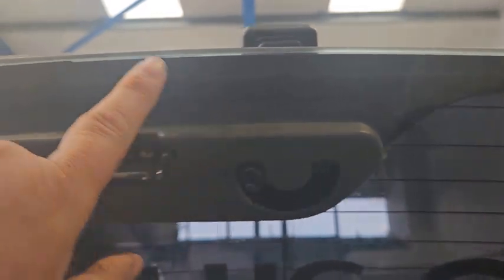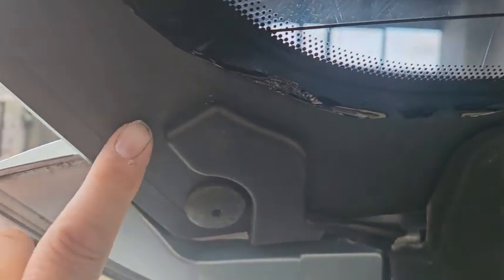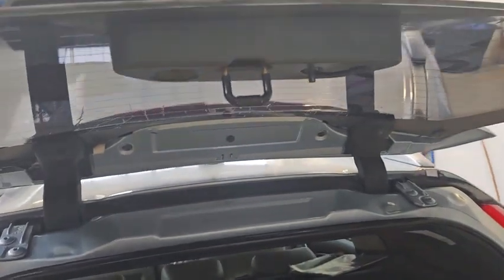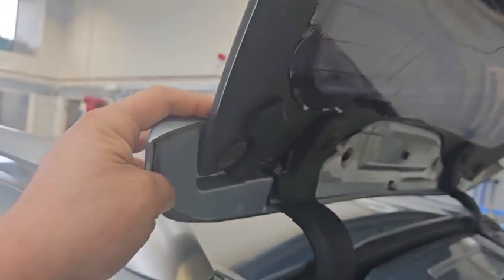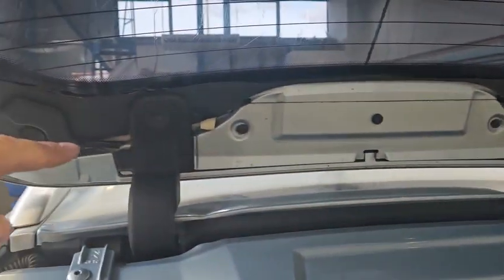The reason why these glasses don't work very well is on the actual wiper itself there's like a little switch. There's a little switch just there, and that normally fails. Two things can fail: one is the switch that fails, but then the actual wire is actually built into the glass. It comes down to here — you've got the proper wire there, but then it goes into this plastic thing, and the wire is actually inside the actual glass. What I used to do back in the day was link a wire from here and glue it to the glass all the way across. But I recently found out that after about two, maybe three years, the switch also fails as well. Unfortunately, this case will not come away from the glass anymore — it's actually solid. So unfortunately I can't take that bit off to get to the wire.